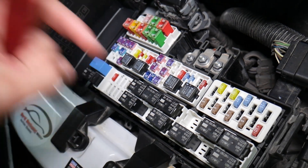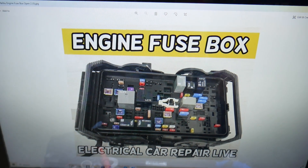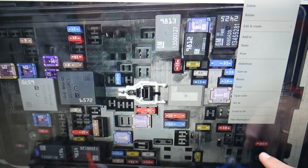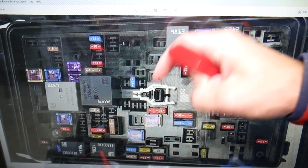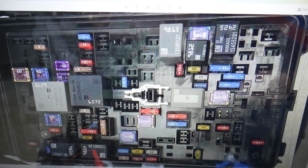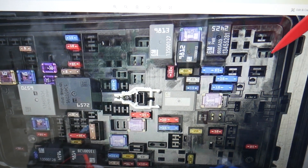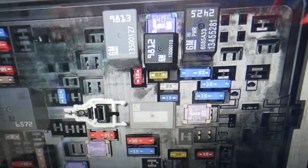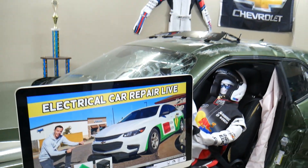Check it out — it will be in the description of the video below. Now, zooming in here, you have five or six different kinds of fuses and five or six different kinds of relays — we'll put links in the description where you can get them at a good price with quick shipping. If you have a fuel heater fuse, the fuse you need to check is known as fuse number 96 — that spot right there. Hopefully the video was helpful. Thank you for watching, see you guys next time.